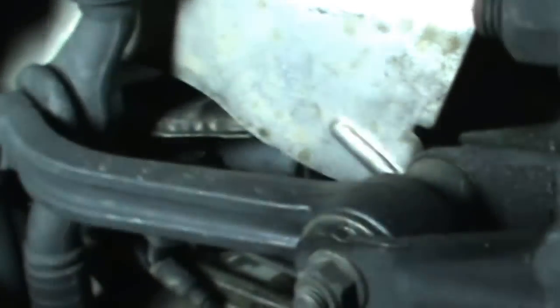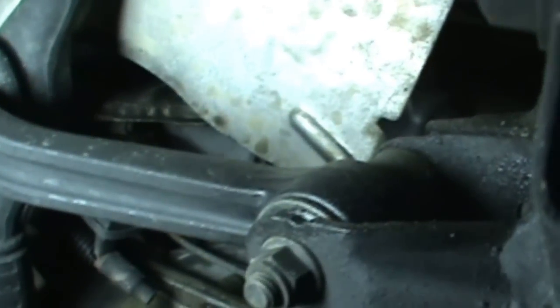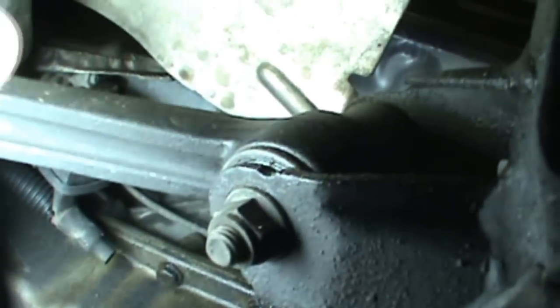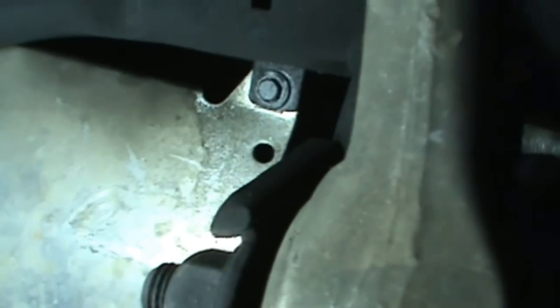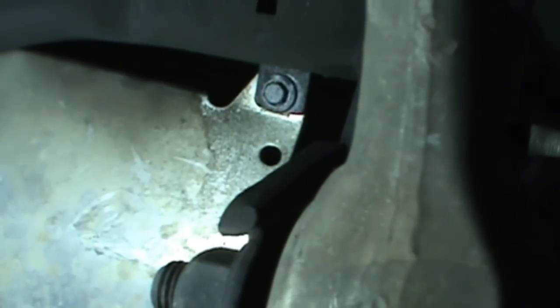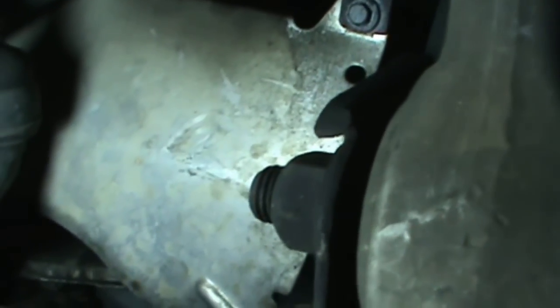So here's the idler arm and the heat shield. I'm holding the light, so I can't really touch it. Let's see, the idler arm is there, and the shiny thing, that's the heat shield. And there's just a couple of 8mm bolts here. There are screws, like sheet metal screws. There's two up front and there's some in the back. There's a wiring harness connected to it. I've had this out before. We'll see how it goes.